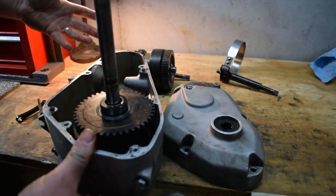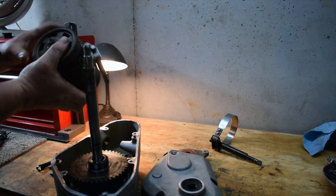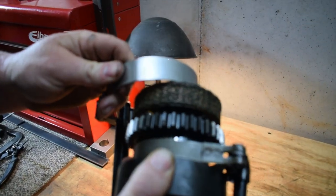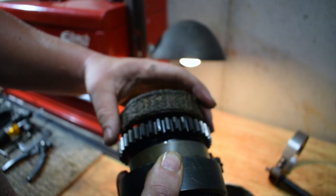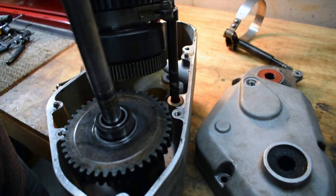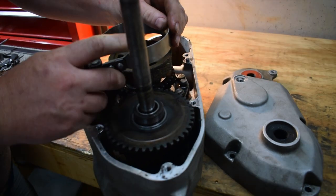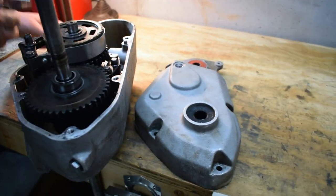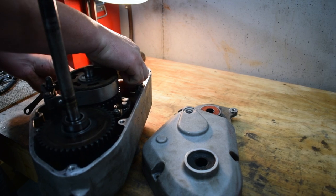As you can see, this is really not that difficult to understand. You don't have to be a mechanic to fix stuff like this — it's pretty straightforward and pretty easy. The clutch was just worn out. You can see exactly where this band, as it tightens up to engage the mower and drive forward, was slipping — so the mower wasn't moving forward. There are bronze bushings in here you can check for wear, since bronze is a soft material. When you put this back together, you line it all up and it goes back together — it's a really simple machine.